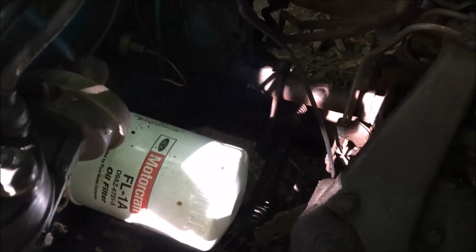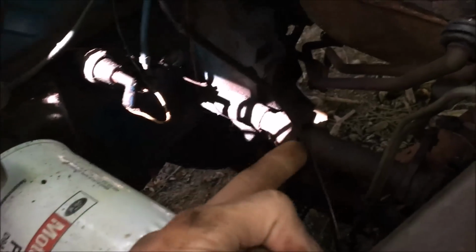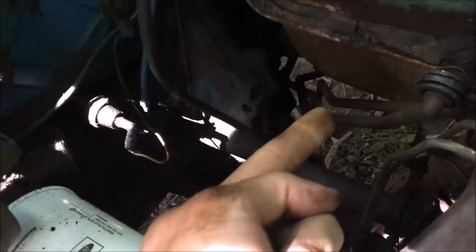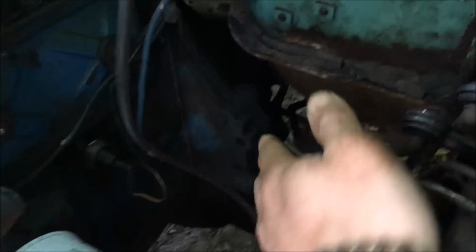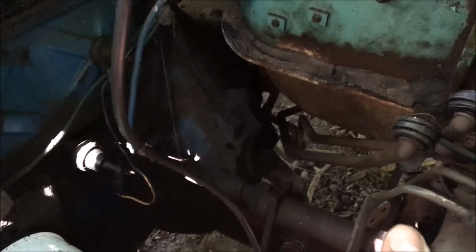Alright, so our clutch pedal isn't working, so down here we have this little pivot arm that has this little lever that pushes back against that clutch lever, so we're just going to take it and adjust it out and lengthen it so that when we push in our clutch, it pushes our little lever farther, and our pressure plate will actually let go of the clutch disc.